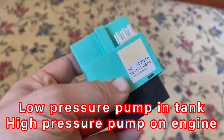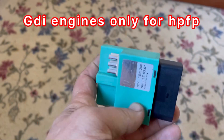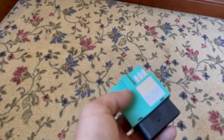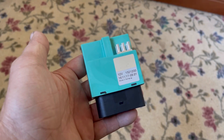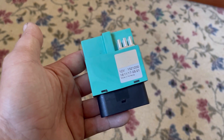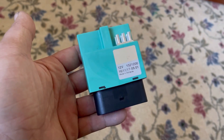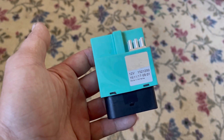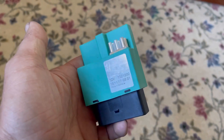This is very similar to a cooling fan control module that you'll see in the bottom right corner of the vehicle that operates the cooling fans. It does a similar thing — it allows the cooling fans, or in this case the fuel pump, to modulate depending on the demand. If you're just idling or driving very slow below 2000 RPM, it allows the fuel pump to run slower. And if you jam the throttle all the way open, it allows the fuel pump to throttle up.